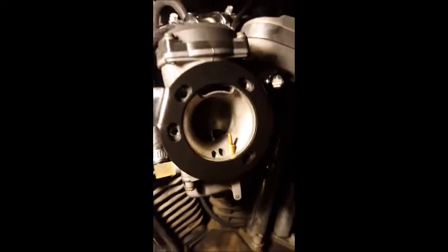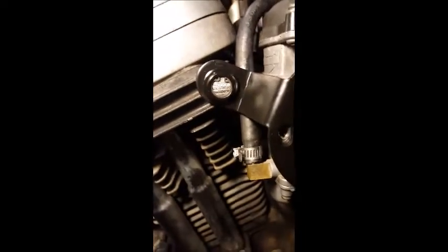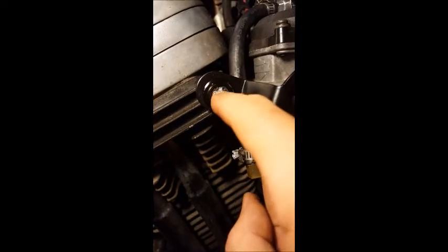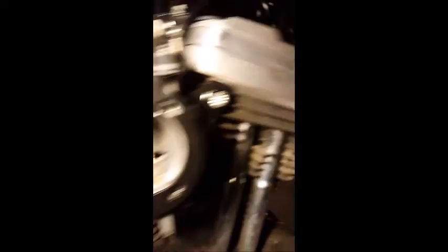Because it's not a matter of if, but when this carburetor ever has to come off, those bolts have to come out and these filters fit in pretty tight. So I'm going to pretty much ruin these little filters getting them back out, because the only way I can see getting them out is prying them with a screwdriver and probably damaging them, or drilling a hole through there and pulling it out. But for now I guess it will work. I can definitely see myself going with a hex head style rather than an allen bolt. I don't like that design very well. I bought it because it was inconspicuous looking and it does look nice, but I don't think it's very user friendly if you ever have to pull this off.